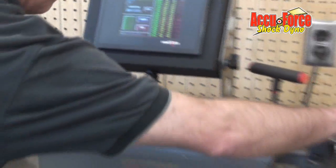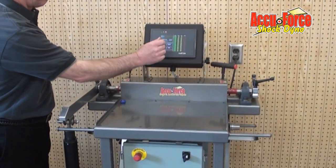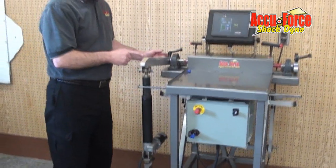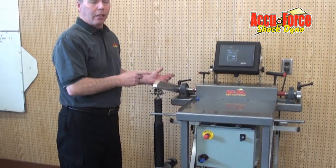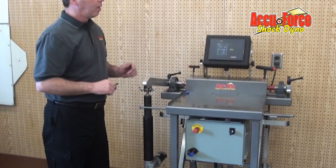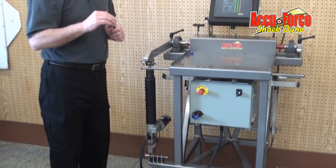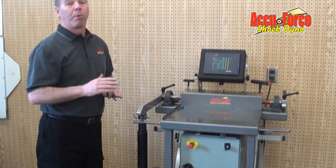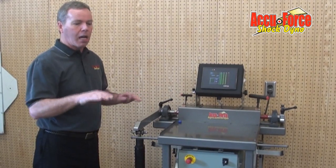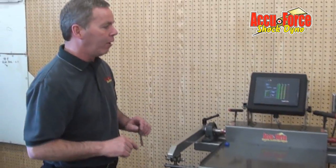We're making sure the two arms are tight. We are going to start to test. This is a 15-inch arm, which is the average length of a sprint car arm. We travel this 5 inches. The 5 inch of travel, from what we know, is kind of an average, like left front, left rear travel. If you think about your sprint car coming off the bars or off the blocks, and then from block height to ride height and complete travel, 5 inch is what we travel it.